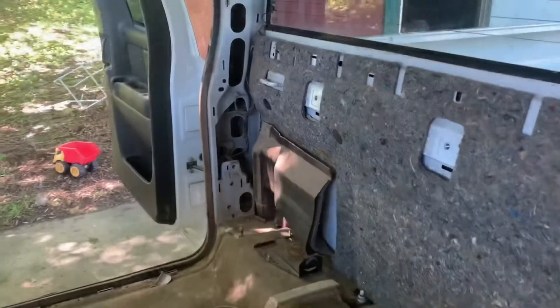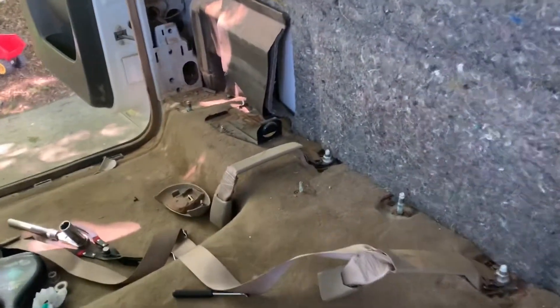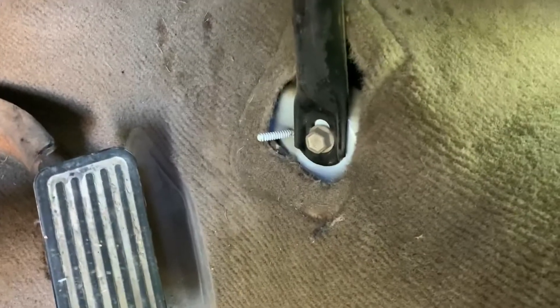Both pillars are out now. This one over here I ended up cracking in the middle - I pulled a little too hard on the bottom and it came out, but the top clips didn't come with it and I ended up cracking it. So just like I said, be very very careful because if you pull on those too hard they'll break. Now we're almost ready to tear the carpet up. I'm gonna take off this piece over here and that bar I was telling you about - you just take off that bottom bolt and you can scoot it back a little bit because if you don't, you have to cut the carpet because it wraps around it.